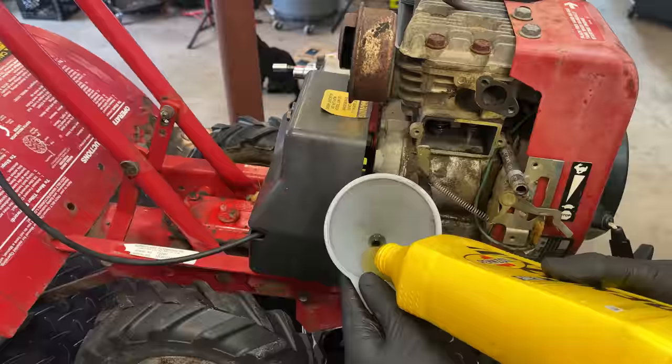So let's see, that should be large enough. To make the circle, although I can't use this because it's only 35 millimeters, I can actually probably use this side to make the circle. It's still a little small, 42. But that's okay, because when I make the circle, I'm actually making it around the 42 millimeter circle that this punch is making. So if I cut kind of on the outside of the line, we should end up with something that is close to 45, maybe a little larger, which I think will be fine.